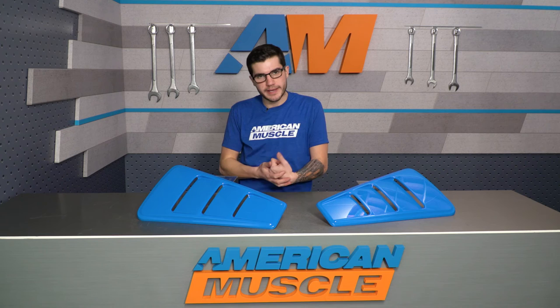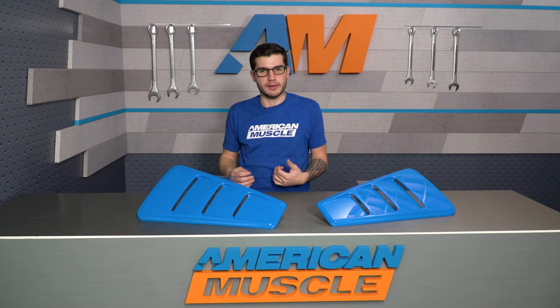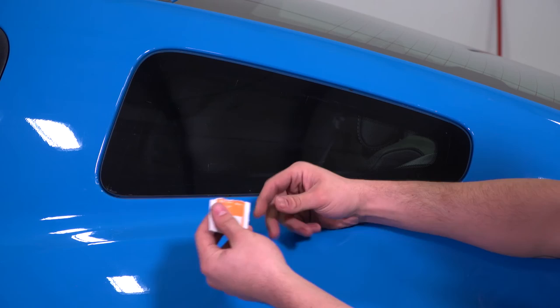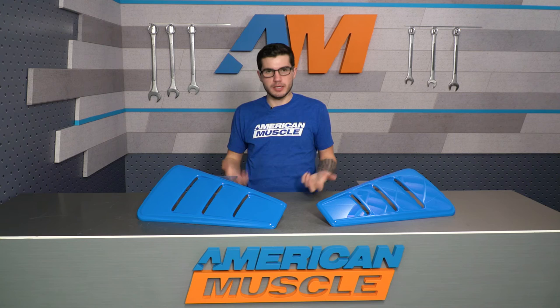As far as installation goes, this one is extremely straightforward. It uses 3M automotive bonding tape — and I want to stress the automotive part, as this is specifically made to hold parts onto your Mustang. It's really, really durable and specifically made for automotive applications. It will require you to use alcohol wipes to clean off the surface on both the back of the Roush scoops and the area around the windows, freeing it of all dirt and dust so the tape gets a good bond. If you ever want to remove them, a heat gun will do the trick and they'll pop right off.